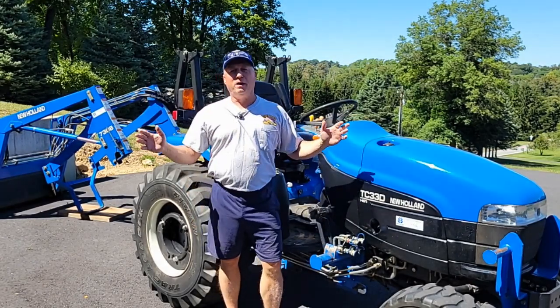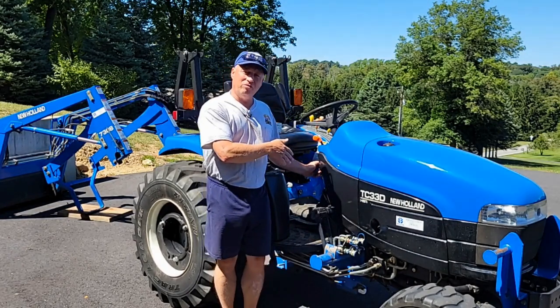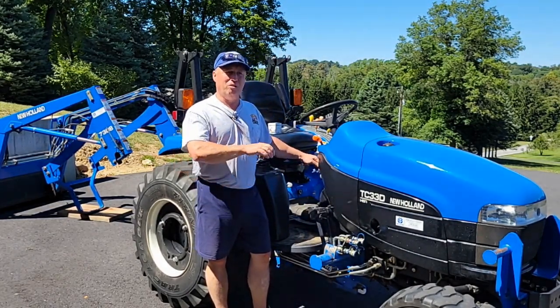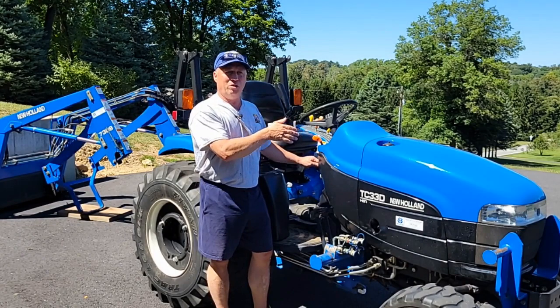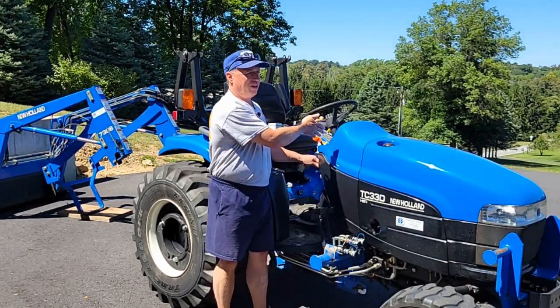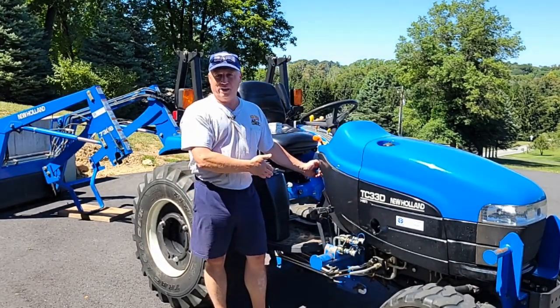I have an unexpected DIY project that needs to get tackled right away. I tried to start up the tractor and the ignition key is very hard to move. I was able to get it started, but it would either catch the starter or it wouldn't, or reignite the glow plugs or it wouldn't. Did a little research. It's the ignition switch.